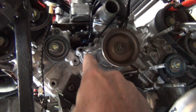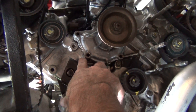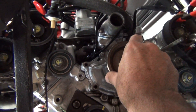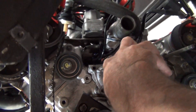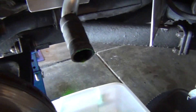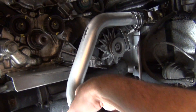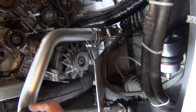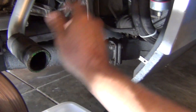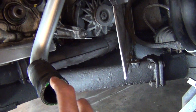I've got all the bolts out and nuts off, but I'm having a hard time pulling the pump off — the whole thing's moving, so I'm having difficulty splitting the gasket. I'm considering taking out the entire thermostat assembly. There's a pipe behind there I need to undo. I've moved that pipe out of the way and drained a little extra fluid. I'm going to remove it completely so it's out of the way — that should give me a lot more access in there.